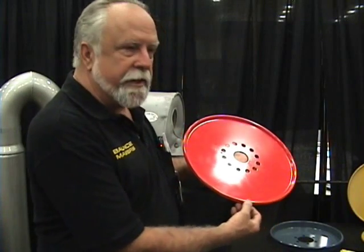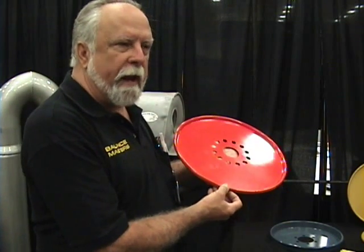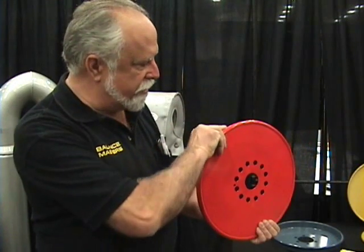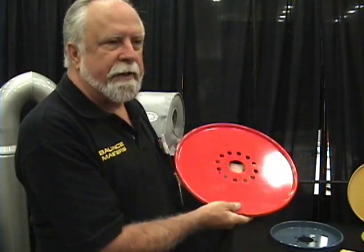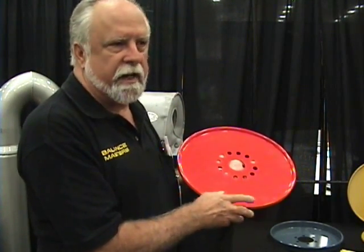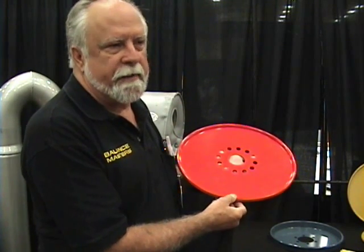And so where's the mercury? Mercury is actually in a small rubber tube, a self-sealing bladder on the edge of every balancer we manufacture. This is one piece of material constructed to roll all the way over the entire edge, which keeps it totally encapsulated. The rubber tubing is intended as a self-sealing bladder — if you had an accident or puncture, it automatically seals up the area so you don't lose any of the material.